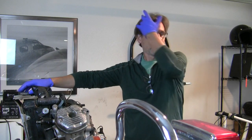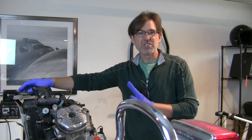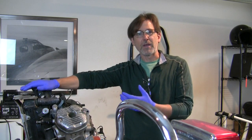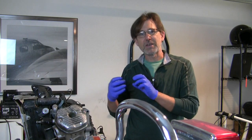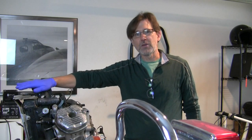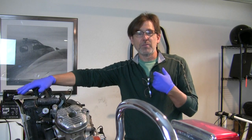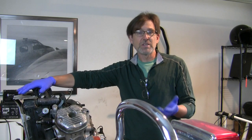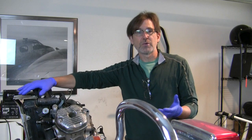This brings up a really important point. What's going to happen if I just leave them out of there? There's going to be wear on that part that shouldn't be there, and there'll also be wear to the engine casing on either side of that gear over time. Now, that's going to happen to me if I keep the bike. But if I sell the bike, which is my intention, that is going to be another person's problem.